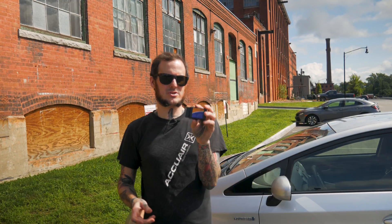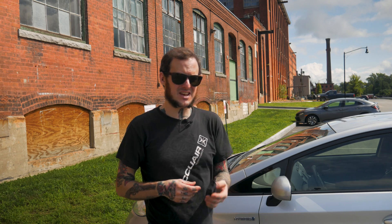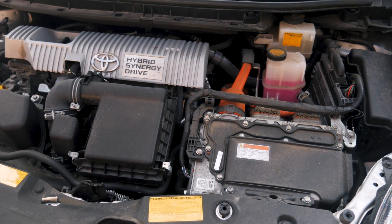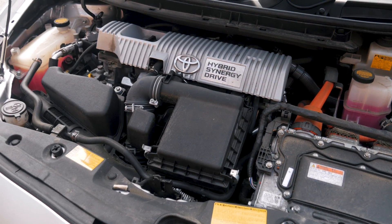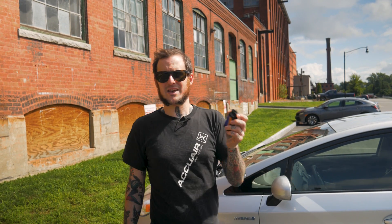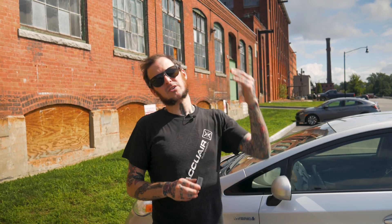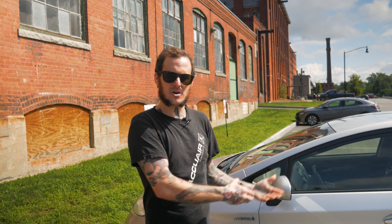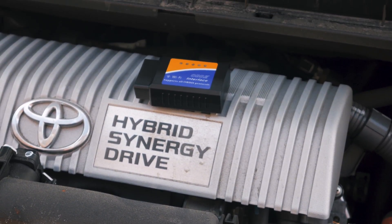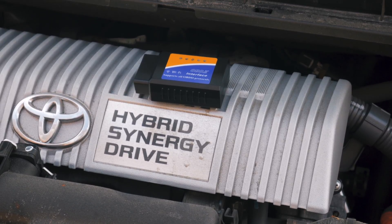This is not one of my in-depth reviews. I showed you using this thing — I only tried it on one vehicle, but it's specifically listed in the instructions that this was not a vehicle I should use it on, and it worked perfectly fine. It cleared the OBD2 codes, let me see them, and showed me live data while running. I did have a little issue with applications — the recommended Android app just did not work for me, so I ended up using OBD Car Doctor. You could pick other software since it uses the fairly standard open protocol called ELM327, which is widely available and used by many different code reader scanner setups. You could try different ones and see what works for you, and invest in a paid version for more functionality.